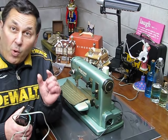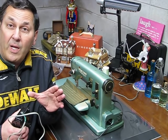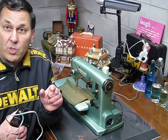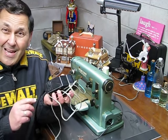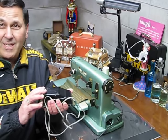You've got to make sure when you're working with sewing machines that you're looking at the amperage factor, whether it's the type of brushes that you're putting into that machine, and they can just be thousandths of an inch off, and your machine might run, but like I demonstrated in that one video recently with Sharon's Featherweight, you've got to get it down to a science if you want to absolutely have the optimal performance from that sewing machine. And when you're matching an incredible Swedish 1.5 amp machine like this, and you're putting it with a 0.8, I think this was probably one that was put out by Mercury. It's been painted, so I can't really tell.